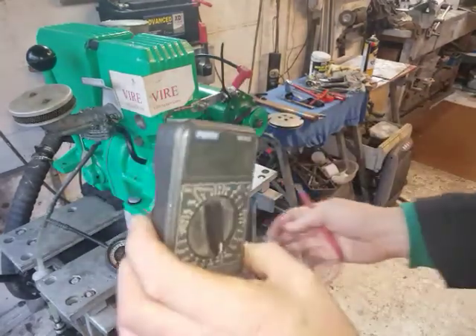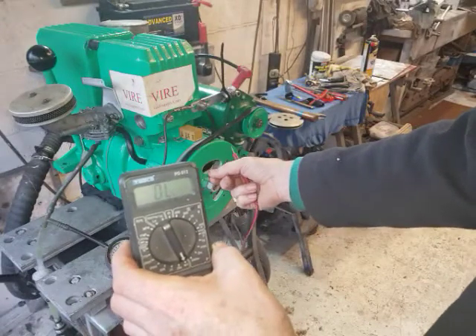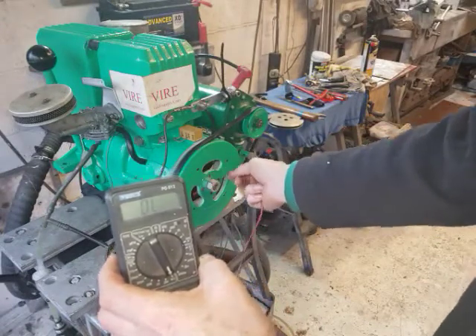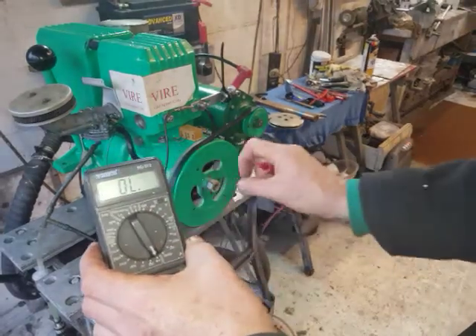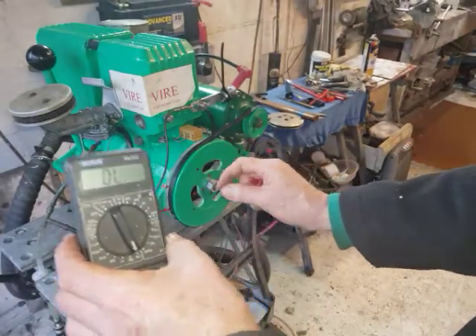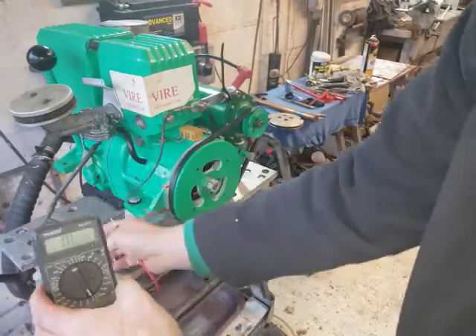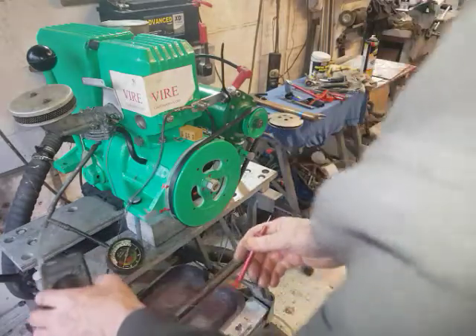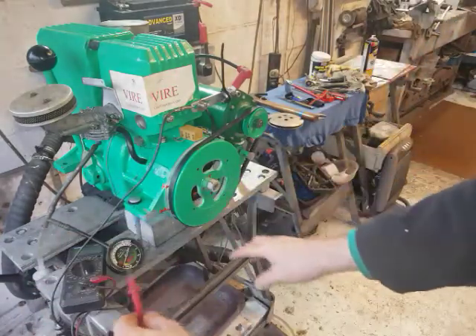In principle, there's a little switch in the ignition which opens and closes, and although this is damped by the condenser you get a slight change in noise when the points change from opening and closing. We're going to use that to check the timing on this engine rather than do it visually — it's quicker and you don't have to use magnifying glasses.